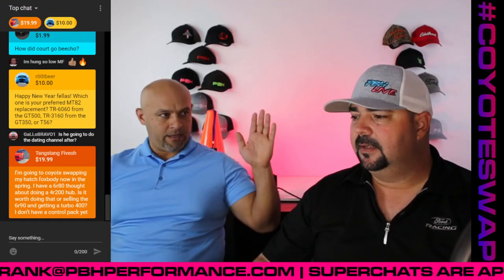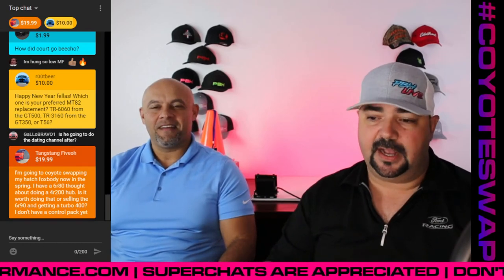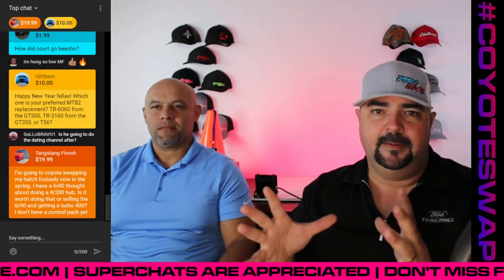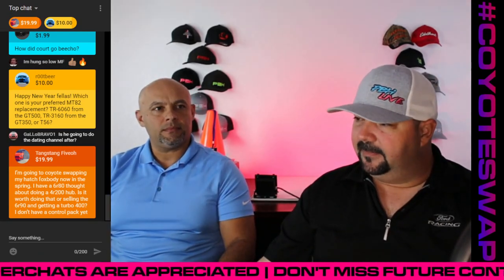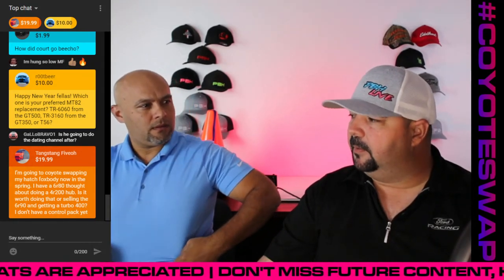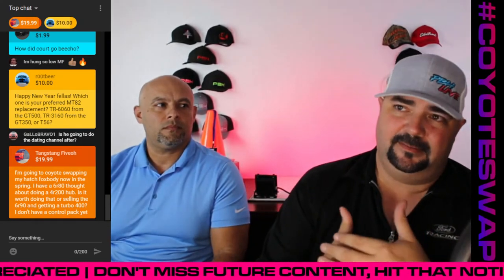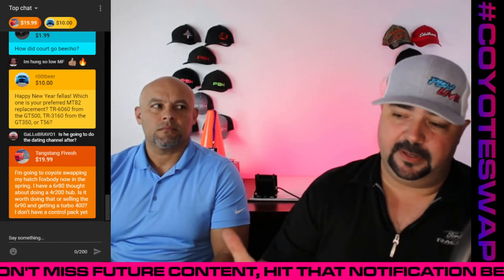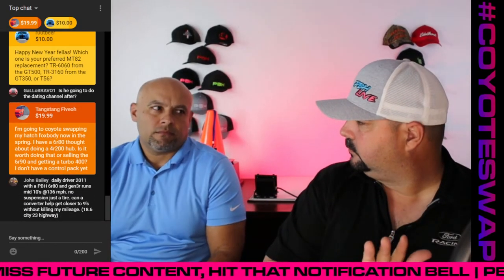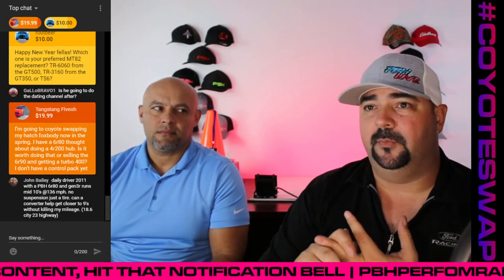For the street, a stock converter gets the job done. The red car had a stock converter at 900 wheel for a very long time, and then it destroyed itself. You can push it and use the stock one beyond what we deem reasonable power limits. When it does come apart though, you're usually dead in the water — it just makes a grinding noise and doesn't move. Sometimes the front pump takes a hit too and ruins the converter. Rule of thumb: if you upgrade your converter, upgrade your trans. At minimum do frictions and steels, intermediate shaft, center support drum, and the forward planetary — that covers all the known failure points up to around 800-1,000 horsepower.